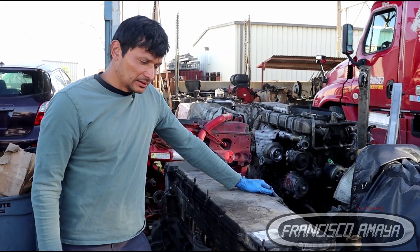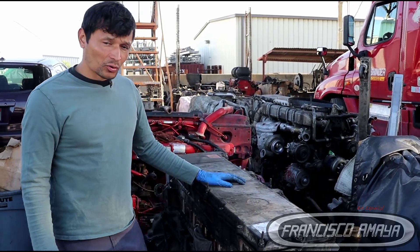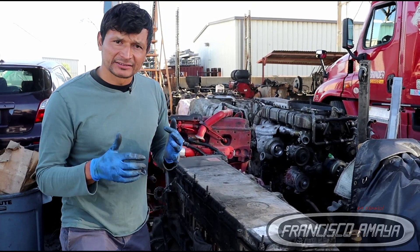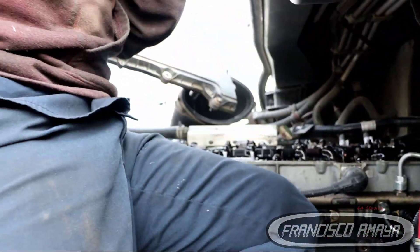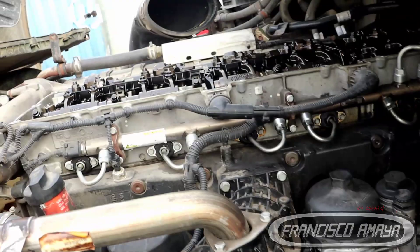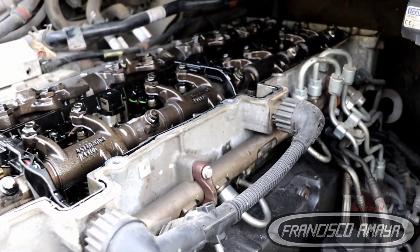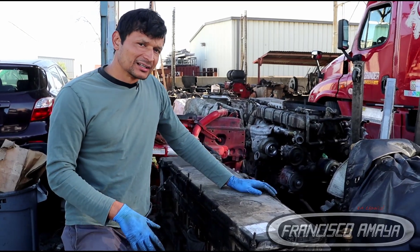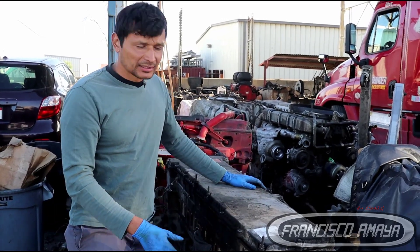To do this job, the first thing is to remove all the top components on the truck. The truck has air filters, two bins, air compressor lines that run from the intake of the air filter all the way to the compressor hoses. You have to remove all these components to get access to the valve cover. In some trucks this process is going to be harder than others — on a short nose Cascadia it's going to be hard, but on a Coronado it's pretty easy because the engine is mostly exposed.